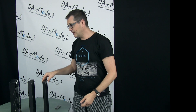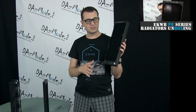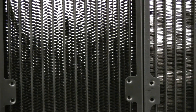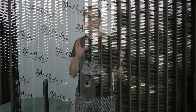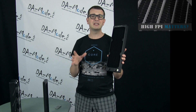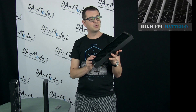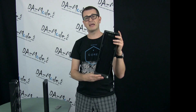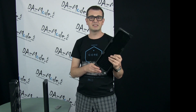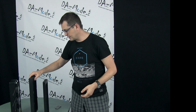The second model is the PE 360 series — it's a little bit older, so it has a slightly higher density core at 20 FPI. We've already tested it. The FPI difference is actually a little overblown in people's minds, so it wouldn't skew our results as much as thickness does. Thickness plays a bigger role here, and the PE is 45mm thick.